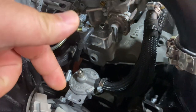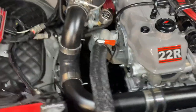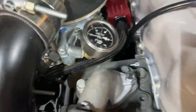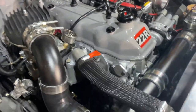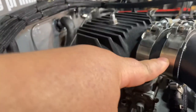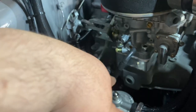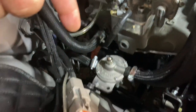It's a different setup from a 22RE where you have the big intake manifold with the fuel injector right before the motor — fuel gets sprayed right before the combustion chamber. In this setup, air gets fed into the carb and everything mixes in the carburetor, so everything in the intake manifold is mixed air and fuel. Burns pretty good for fuel.